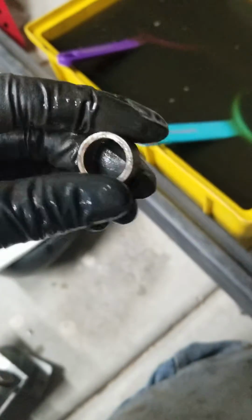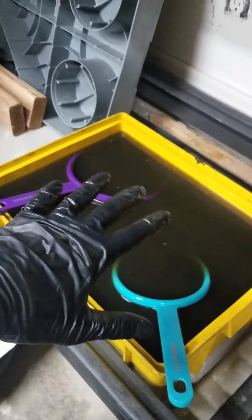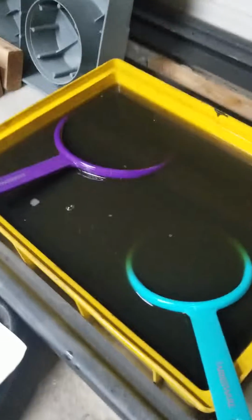I have to dump that down in. There we go. And then we have this spacer here. That's going to go in the little blue one. And then this, I'm not going to try to take off the bearing actually. We're just going to leave it on there. And when it comes time to clean it, we'll just pop the seal, clean it out, put a little bit of synthetic grease in it. This, I'm just going to put straight down in, right there. And then this, I'm not entirely sure this will fit. But I think we can. Yep, it fits. No, okay, I almost spilled this. Not the evaporust, I almost spilled the contents in the blue strainer. Alright, there we go. We have everything soaking in evaporust, except for the chains, which I think I should throw in right now.